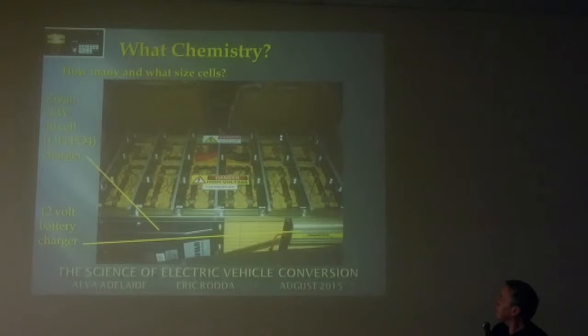That shows the battery frame with all the cells in it there. You can see at the back there where the cables disappear through the back where there's two fake cells. I painted some wooden blocks yellow, and they're hollow wooden blocks, so they're not too heavy. And they disappear through the back, and there's a box at the back there where the cables terminate, with a circuit breaker and also the shunt for the metering.